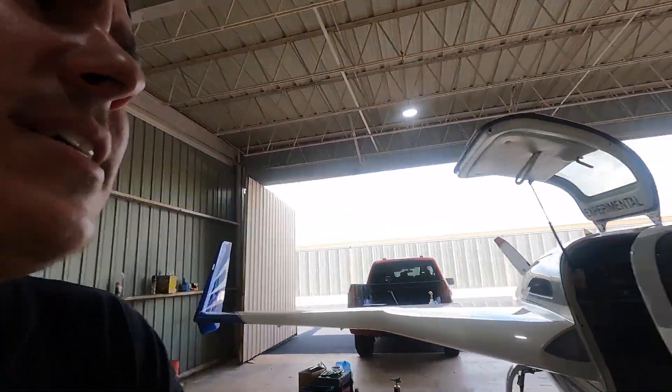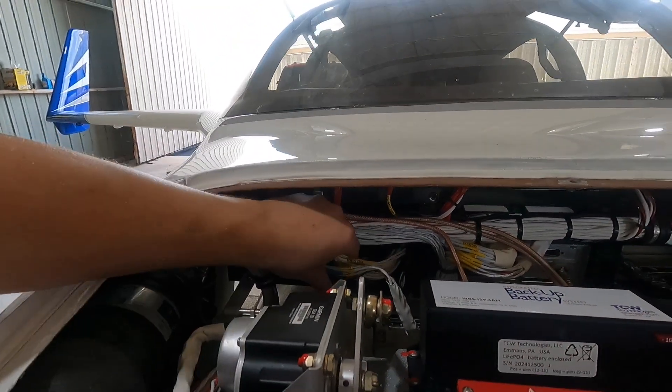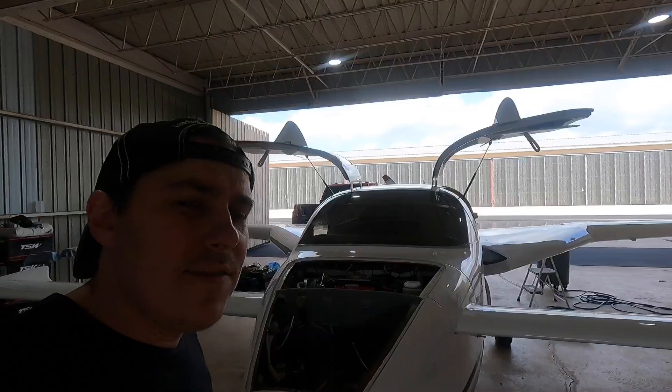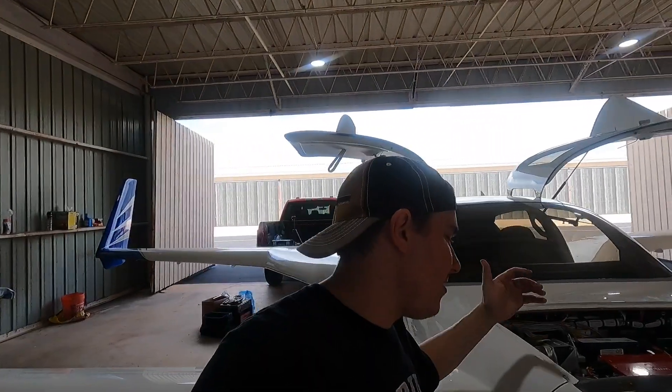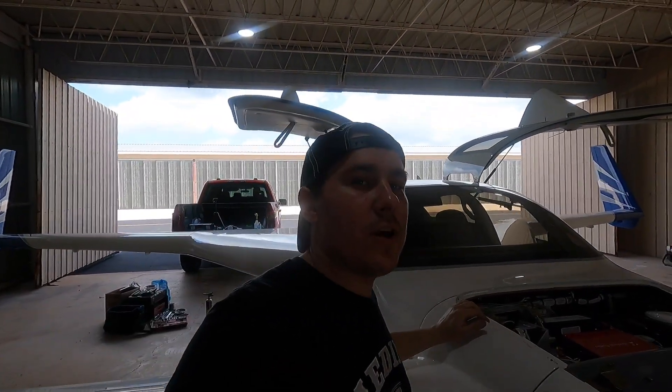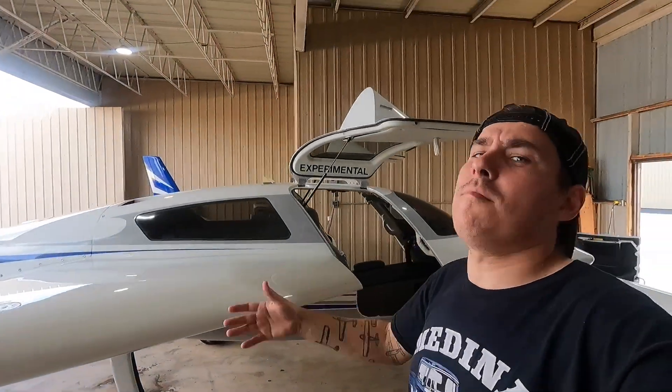I'll show you where that landing gear controller is — it's right back here behind my finger on this panel, and this is the wiring harness for it. Everything is labeled nice and pretty, and that makes it a lot easier. But the point is, because the airplanes are built by some chaps in a garage or hangar, and they may have deviated from the drawings, it can make every experimental aircraft a little unique. As a mechanic doing a condition inspection, you end up doing quite a lot of familiarizing with the aircraft before you even start — looking at drawings, trying to determine how it was built and in what manner things were done — so that you can adequately service it without it being dangerous.